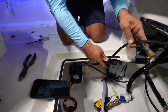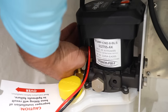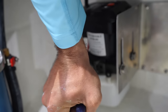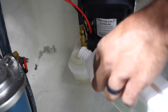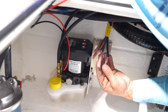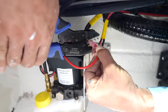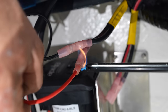Now we're going to attach the hydraulic lines to the pump. There are two different hydraulic lines: an up hydraulic line and a down hydraulic line. You have to make sure that you attach the up hydraulic line to the up fitting on the pump, and the same for the down hydraulic line on the down fitting. Moving along, we're going to add some hydraulic fluid, which Power Pole includes. Pathfinder actually pre-wires their boats for power poles, which is very convenient. All we have to do is add some heat shrink connectors — red goes to red, black goes to black — tighten them down, and add heat to the shrink connectors to make them watertight.